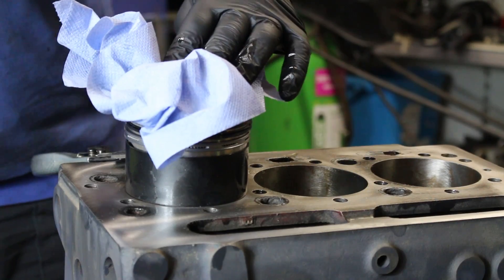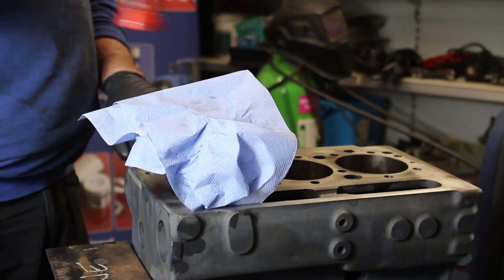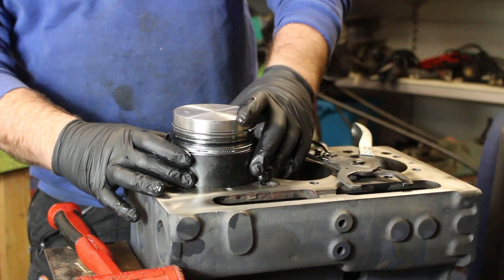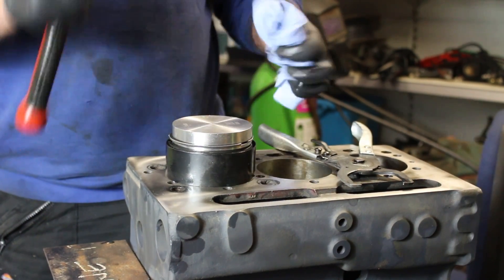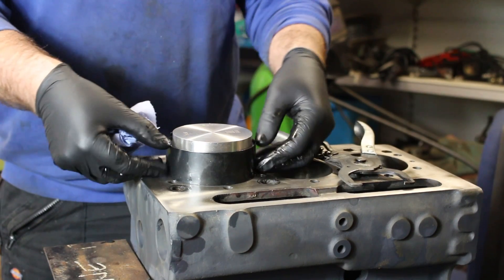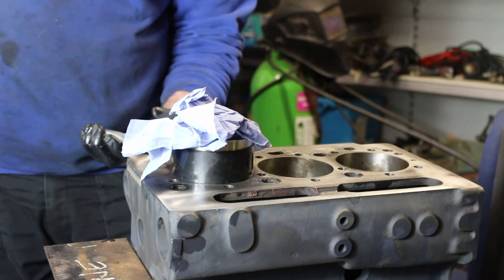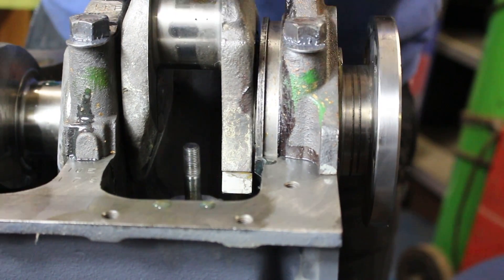Next job — our piston ring compressor. Put a little bit of oil on that and then over. This is one sort of piston ring compressor that I use and we clamp that in place, close it up nice and tight, then just give it a tap to get it started. I've had other ones where they're a bit deeper, so we'll let that go down a little bit further until all the piston rings are encompassed inside the ring.